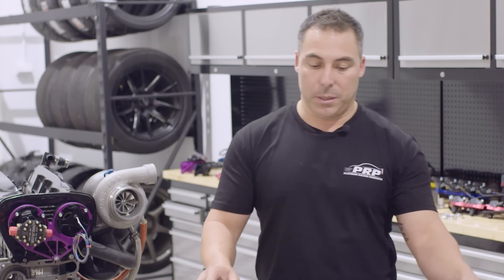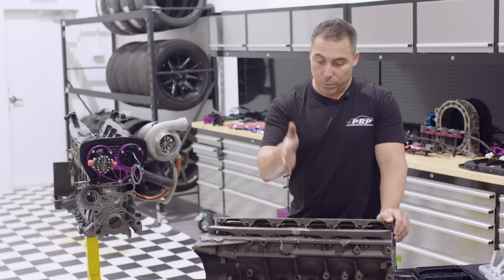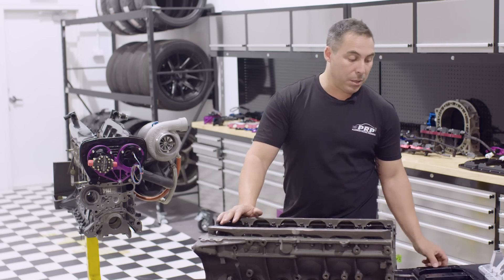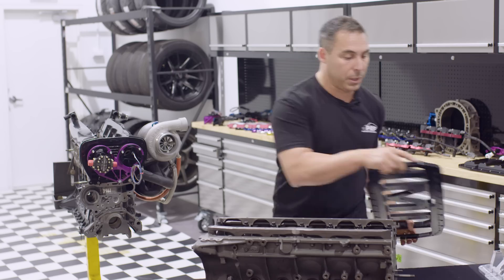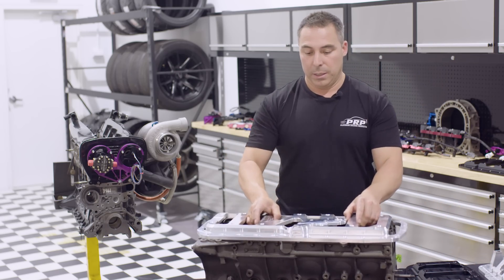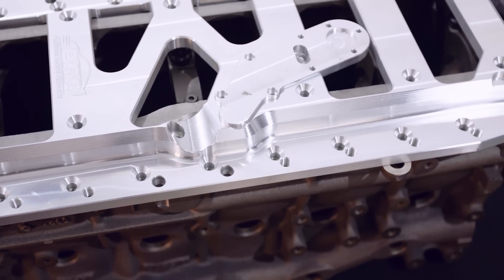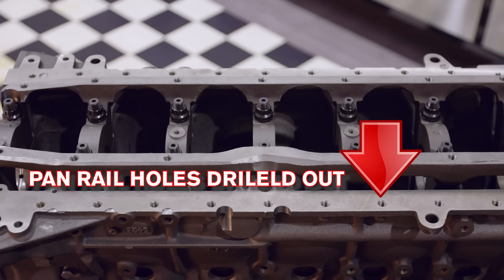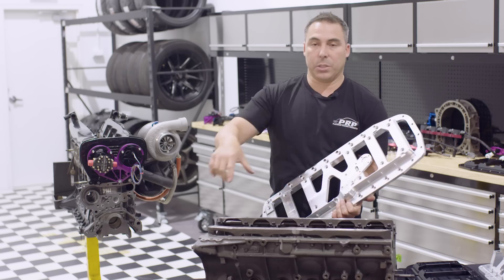There are predominantly two different block types that Nissan manufactured. The two-wheel drive version — RB20, RB25s, and RB30s are all the same; they have an oil gallery right in the middle of the block. So if you're running a dry sump setup with no drive shaft in the middle, you can run a dry sump brace, which is this one. If it's going to be four-wheel drive, it has to be either a dry sump brace because the drive shaft's in the way, or you go to our wet sump brace, which has got an oil piping gallery through it — allowing you to run a dash 12 port fitting for an oil pickup where it should be over the side there. All our braces need some machine work done on the block, whether it's two or four-wheel drive. The pan rail, where you usually have an M6 bolt hole, you have to drill that out to M8 by 125 the whole way around. Then we insert all these new holes in the middle of the brace, and that's what allows the centre of the brace to attach to the main cap cradle.